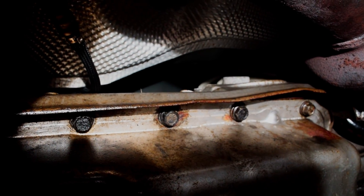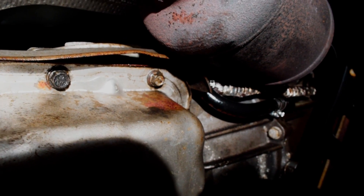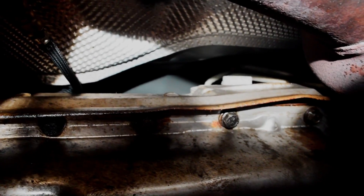I've moved on to the underside of the car after getting those lines off up there. You can see our temporary repair right here - that's where the line actually rusted. I assume that's a common spot for these cars. Right up here there's a shield that goes around the pan - I bent it a little bit to get it off the pan. There's a 13mm bolt right up there - two of them actually. Here's another one right near the O2 sensor and the other one's right here. I'm going to take off those two 13s to drop the shield down and give me a little more room to get my arm up in there and mess with these transmission cooler lines. It's not going to be easy - this is a moderately difficult job because it's hard to see up in there.